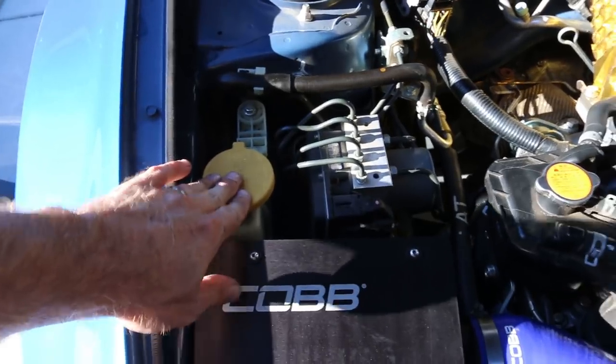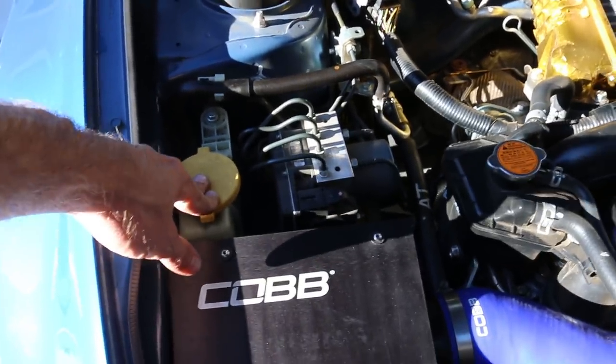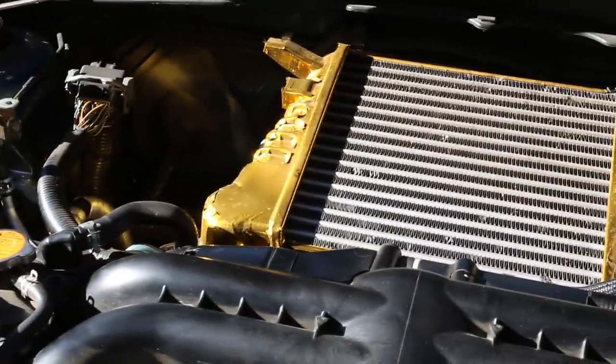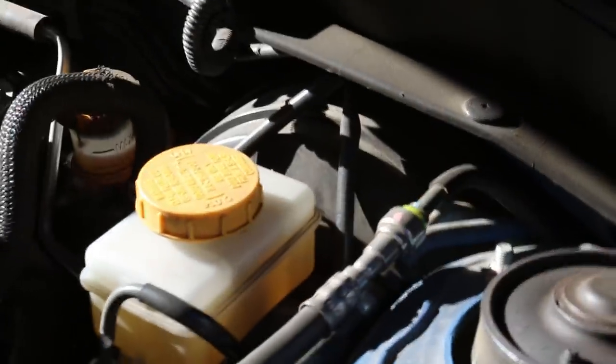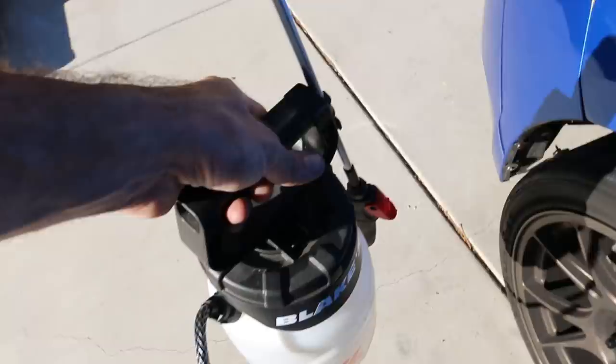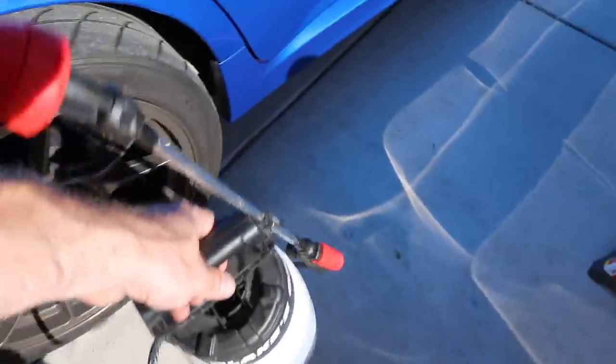Those number cards are getting thick. Quick check of your power steering fluid — check the color, make sure it's not super brown, should be pretty red. Check your coolant, check your engine oil. You can also check your transmission fluid and brake fluid reservoir — make sure it's all full and clean. I also have my water jug filled with fresh water. I usually put it behind the seat so it doesn't fall over. I have all my audio equipment back here too.